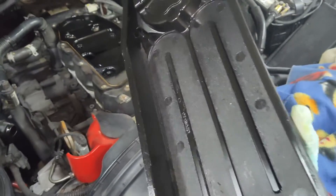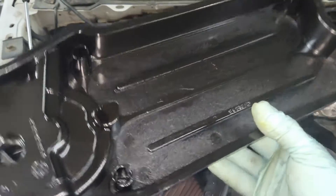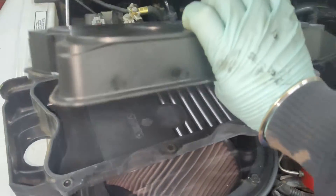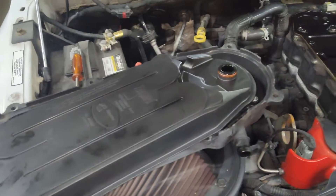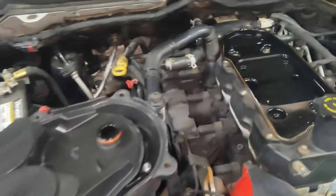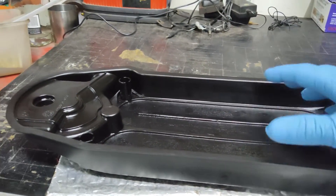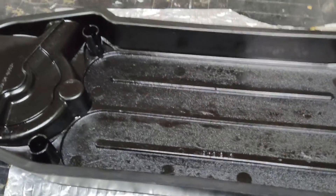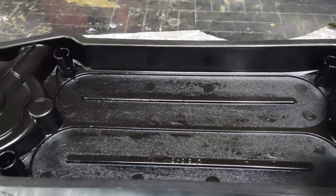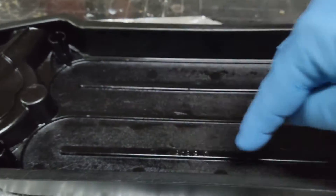As you can see, mine has been completely gutted — there's no filter material in it, just the casing from the CCV filter. I've seen some people completely delete the whole thing and just put the cover back on. Here's our gutted CCV filter — this is where the fiber material is supposed to be. I've ripped all that out. You can usually grab it with pliers and then scrape off the remaining glue or fiber with a razor blade.